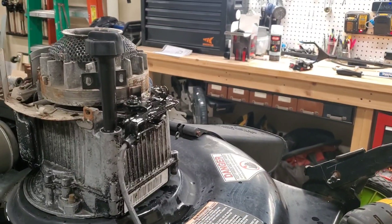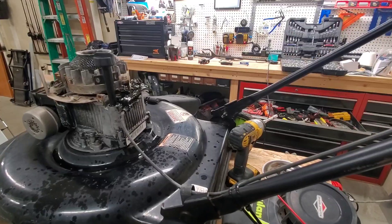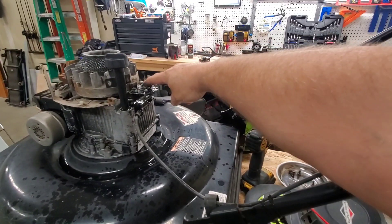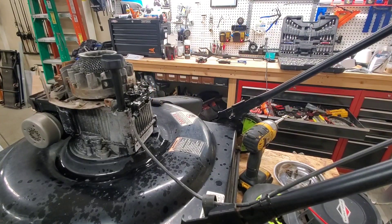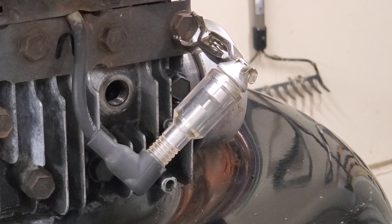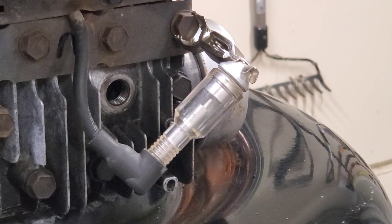Now it's moving back and forth, which will turn the coil on and off. It was stuck in the open position — from the switch to that lever, grounding through there. So if we had gotten it started it wouldn't have shut off, and pulling the coil from the plug can get you zapped — not recommended. Now we're going to test that we have that switch moving.